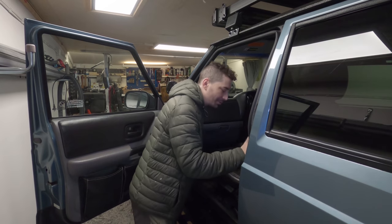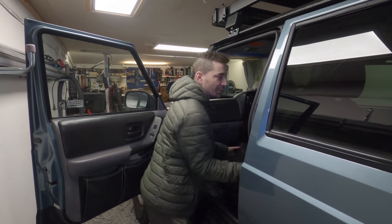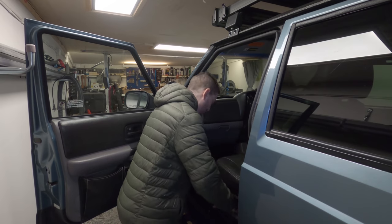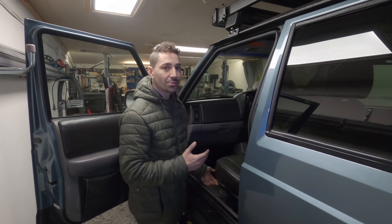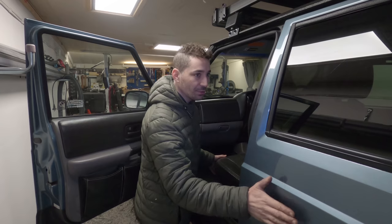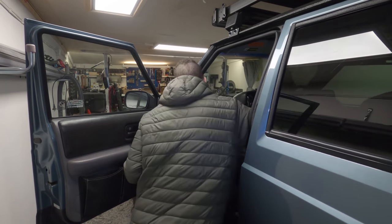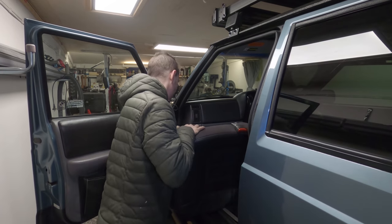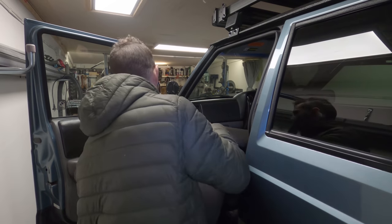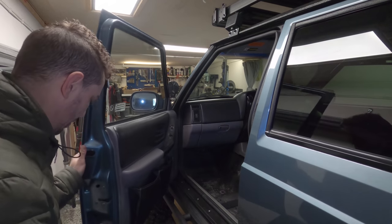Let's get the other seat out and start on the other side. There are four bolts - three bolts and one nut holding the seats in. The way I like to take the seats out, to avoid scratching the vehicle, is make sure the rear door is closed first - if it's open you'll probably drag the mounting point across the door. I usually turn the seat and take it out so the soft bit is on the sill, then walk the seat round, and it comes out generally with zero problems.